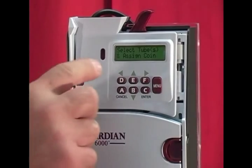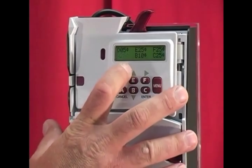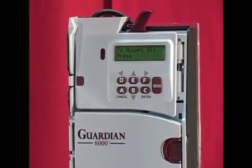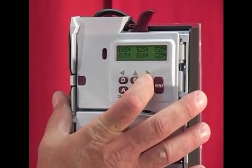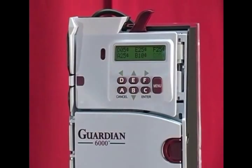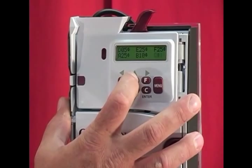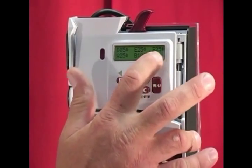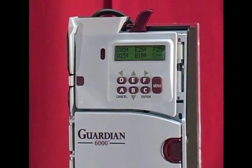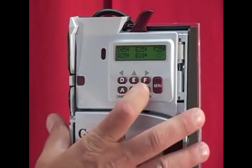Now the display will show — use your arrow keys to move sideways to the tubes or up and down to change the value. Right now, the A tube is blinking 25 cents, and that's the tube in my A location. I changed my C tube, so I want to move sideways using the F button to get to the C tube, which now is a nickel tube. The display says it's a 25-cent tube, so I want to change its value using the up or down arrow keys. Scroll up — it says a dollar, then two, and when the display has three bars across it, that will disable the tube. I want to scroll up to where it says C, five cents, and then enter that.